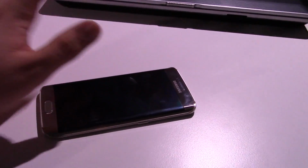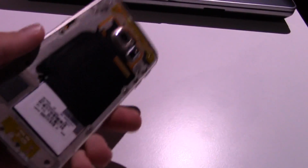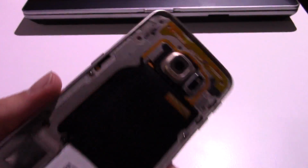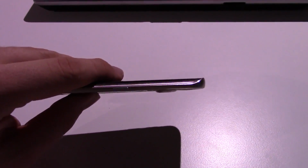What we're going to be doing in this video, I'm recording this clip tonight, and I'll record another clip when I actually replace the display, probably tomorrow. But for now, we're going to be tearing this phone down and getting it ready for the new display. The way this phone is built, with this aluminum mid-frame here, the phone is built front to back, so the board and the battery and everything else attaches to the display assembly and then kind of slides down into this mid-frame.